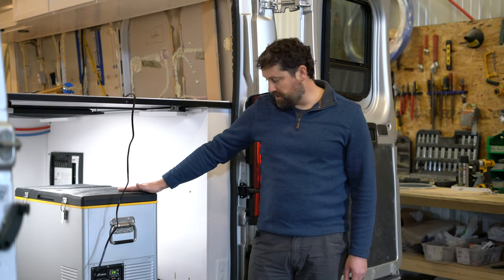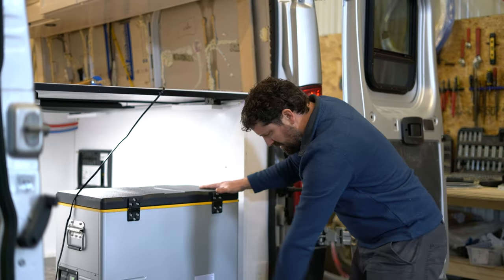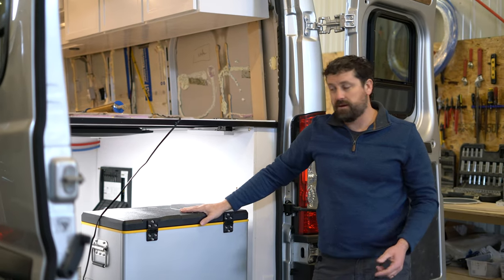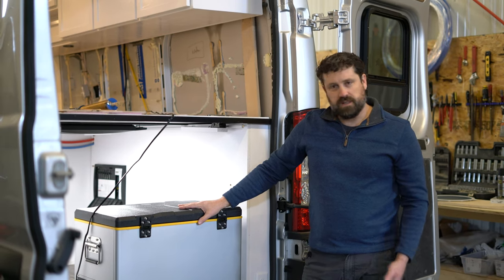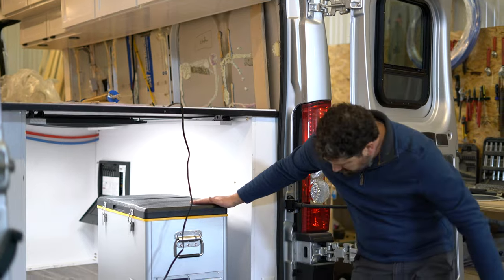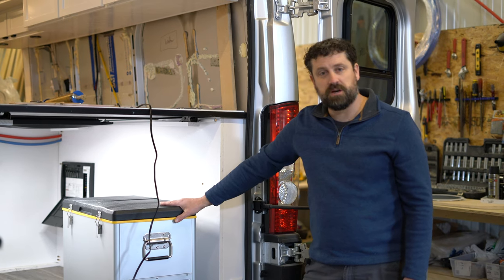We have it plugged in and running. I'm surprised at how quiet it is — very quiet. On Amazon it says it draws 7.5 amps, and the label on the back also says rated current DC is 7.5 to 3.7 amps. However, we plugged it into our battery monitor and it actually runs at only 2.2 amps — less than what it says. It cooled down very quickly too. We plugged it in about a half hour ago, it started at about 50°F, and it cooled down to 14°F in that half hour. It's very quick and efficient to cool, and draws only 2.2 amps.